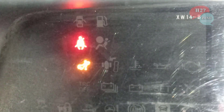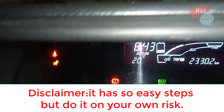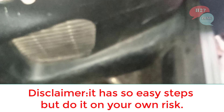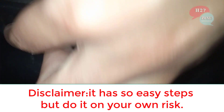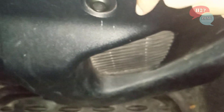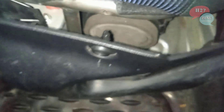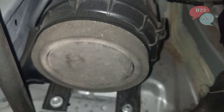This hybrid battery fan is located in the back of your seat. Let's see how we can clean our battery cooling fan. First, we need to remove this plastic bolt — push from the center of the bolt and it will come out. After removing the plastic cover, you can see the cooling fan which helps cool all of our hybrid batteries. You can see it has a lot of dust that we need to clean.